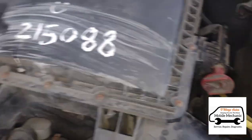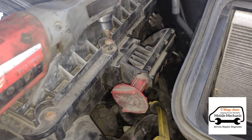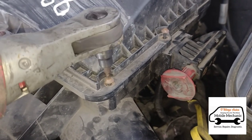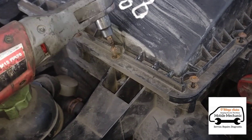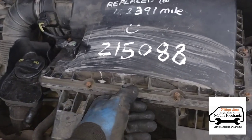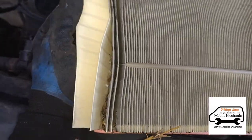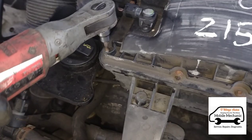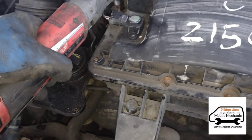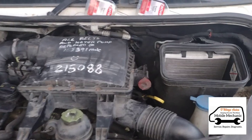There are a few screws going around the air box, so we're going to open these with a T25 Torx bit and open all of them. Once they're all open, lift up the air box and pull the filter out. Here's the old filter — open some of the panels and you can see how much dirt is in there. We've got the replacement filter in, slotted the top back on, and just tighten back up all the screws. Now that's done, we move on to the cabin filter.